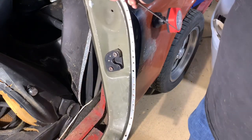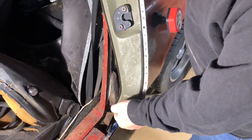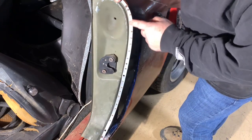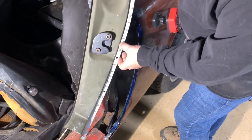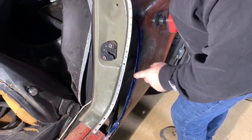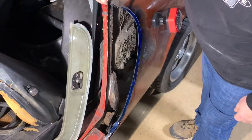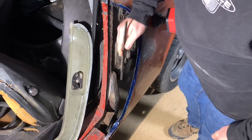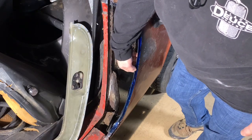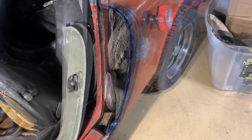That's why somebody cut this one out of a Porsche. It's almost brand new looking, but it was already in a Porsche, and it's got some primer and stuff on it. But I'm going to weld up all the holes that aren't all the way through. I'm going to weld all of these up, grind it all back down smooth, and then get it to where it fits inside here. But today's goal is to find the spot welds, punch them, drill them, and remove the back piece right here from the original part. So that's what I'm going to do, and then we'll test fit that.